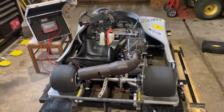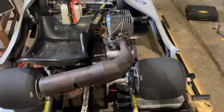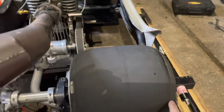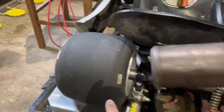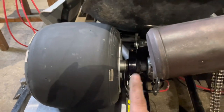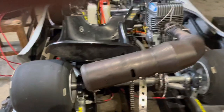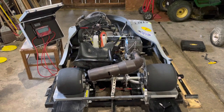Taking another quick glance — one of the things I want to mention is rear track width. That is essentially the contact patch from outside to outside. When it's asking you for your rear track width, that is going to the contact patch where your tire runs. These are a set of scuffs — I've had them on track before. You're going to measure from this point all the way over to this point. They may even mention how far they want your rim off of the frame rail or cassette — just things you want to pay attention to when you're scaling.